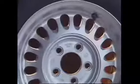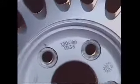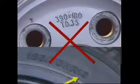Totally metric types are also manufactured. Here, 190 is the section width in millimeters; the aspect ratio is 65%; the speed rating is H for up to 210 km/h; R indicates radial ply construction; and 390 indicates the tire is suitable for fitting to a 390 mm diameter rim. Metric diameter rims cannot be fitted with inch diameter tires or vice versa.